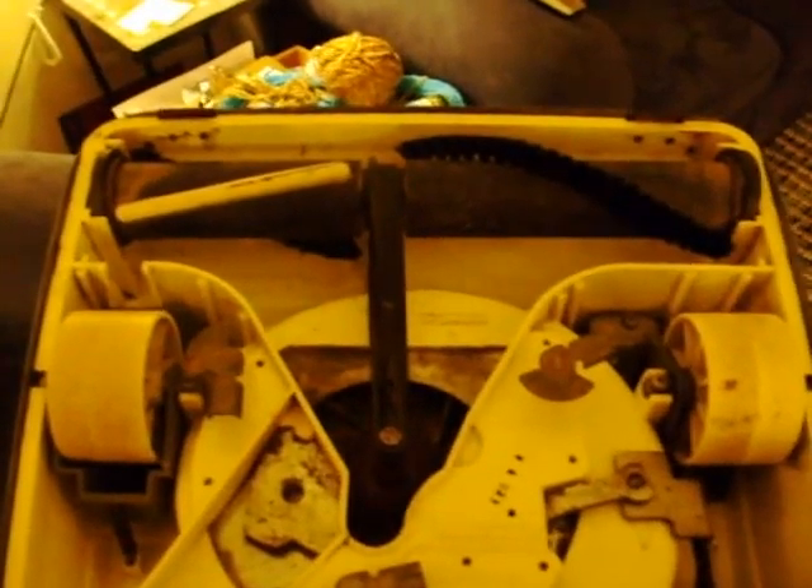And then this is the channel that goes back to plug in the attachments. When you want to use the attachments, you push the lever on the side — not that one, this one. And that metal covers the hole and sends the suction out that side port. What it also does is there is an electric switch right below my finger, and that electric switch will switch the machine to high speed. So that is what Premier referred to as its Vibra Clean brush.